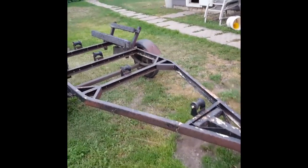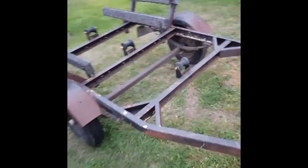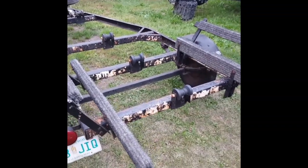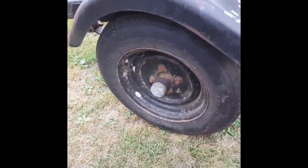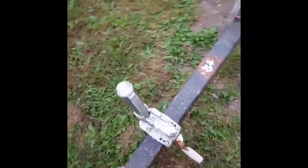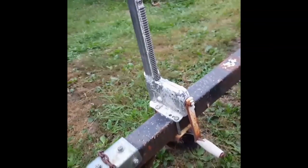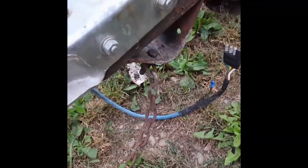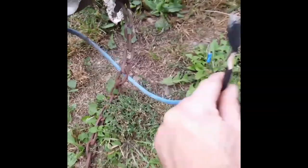About a week ago I uploaded a video — Marine Mark pulled a trailer out for me, which I posted on Instagram. He pulled it out of the bush. I bought a boat at auction that didn't come with a trailer, and you know how that goes when you're a mechanic — big ideas, big plans. So I had to get the trailer figured out: get the bearings sorted, get the lights going, bring it two hours across the province, and make sure everything was safe before putting it under the boat. It had a Fulton jack on it, kind of vintage, but the safety chains and wiring needed work. I sorted out a ground issue and got the left, right signal, and clearance lights all working.